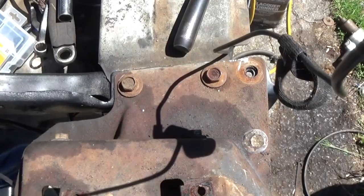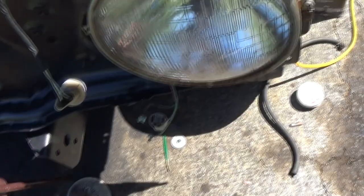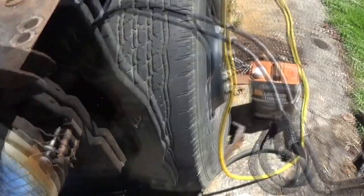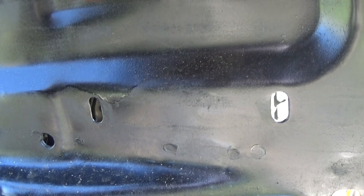Right, now we're back over here on the 74, because, you know, I told you we're going to change the square headlights. So I took this piece here and the headlight assembly off my 78, and I went ahead and bolted up here and here, here and here. And what we got to do, because here are the original two mounts for the round headlights from 73 to 77 for the split grill. You can see where the new ones are at.